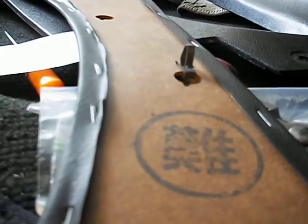It uses those kinds of pins there. That's the trim piece that was mounted right here. This used a regular old-fashioned kind of snap clips to get out. To do that, I used one of these tools here — it's a basic panel removal tool. What you want to do is make sure you get underneath that clip and pop it so you don't damage the underlying substrate it's attached to.